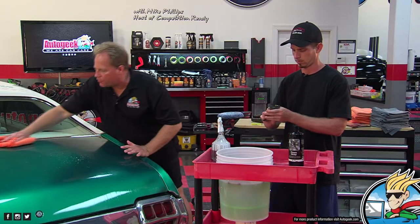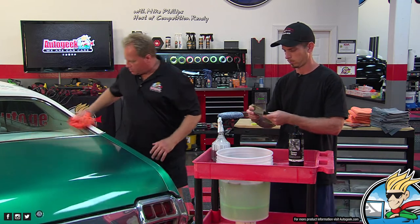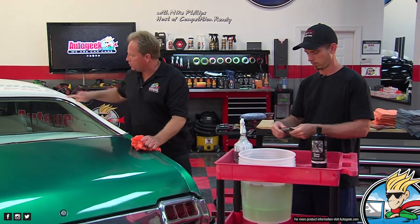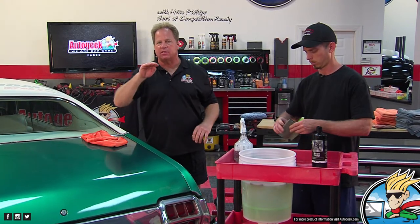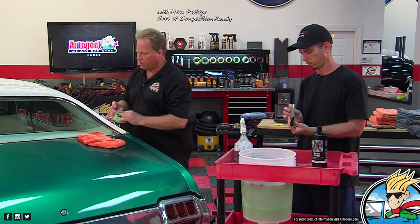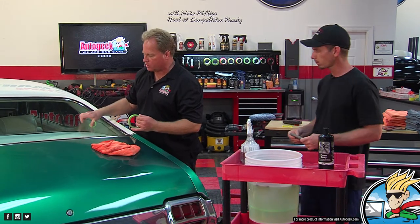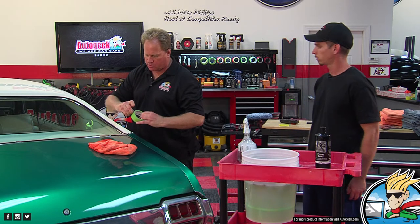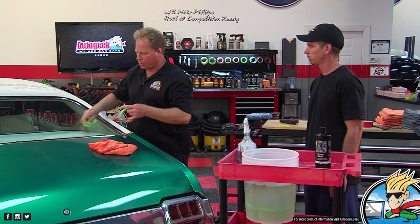Well, when we were first starting out, Yancy, remember I showed you the DA sanding marks in his trim? What happened is when they were doing the prep work, they didn't tape this off very well. You can actually see places in the trim all around the car where they ran the DA sander with the sanding disc into the trim, and there's now DA pigtail sanding marks in it. So it's just a good idea to mask, whether hand sanding or machine sanding, because it only takes one pass by hand or machine to put sanding marks into stainless steel trim. You can get them out, but now you're going to have to become a customer of eastwood.com, and buy all these really cool tools for working with stainless steel.